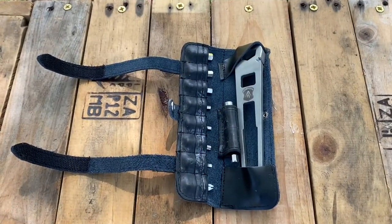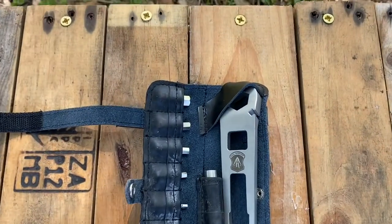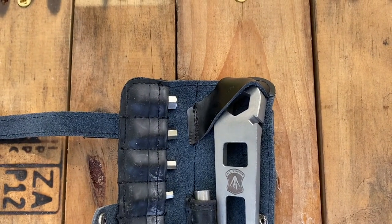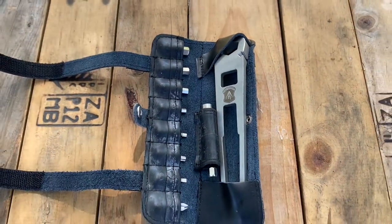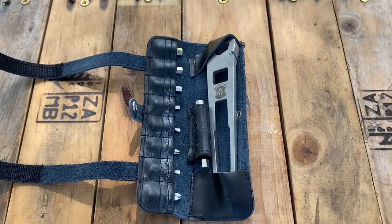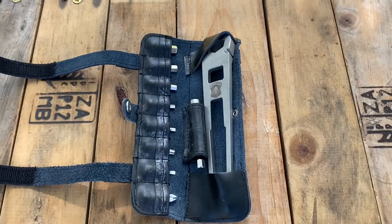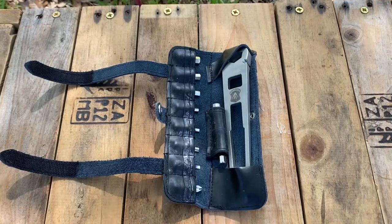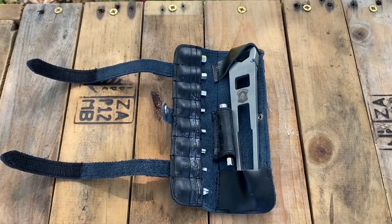This is a very nice, well thought out tool. What's nice is if you do not have quick release wheels, you have a 15 millimeter wrench in the head of the tool and you can add the allen keys. Now, if you had anything like fenders that had either eight or ten millimeter nuts, you wouldn't be able to adjust them with this tool. Nevertheless, this is not a bad tool to carry on your bike or use for minor repairs if you can do those on your own.